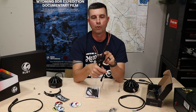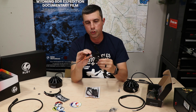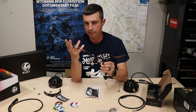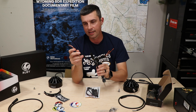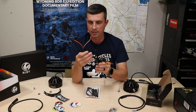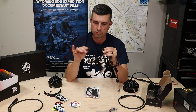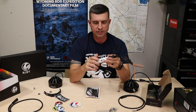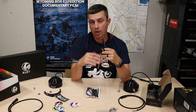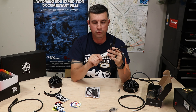From there you're left with four auxiliary plugs. My plan is to use two separate plugs for each individual light — this will be the left light, this will be the right light. I'm using a three-pin setup because I plan to dim with this module and the wonder wheel. I inserted the three-pin wire onto this plug. The amperage this is rated for was borderline for one connector running both lights, so I wanted the ability to run both lights at full brightness without worrying about the module — that's why I decided to split them up.